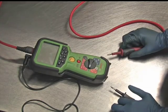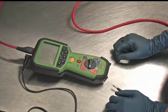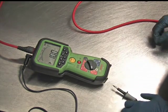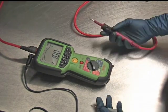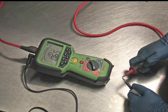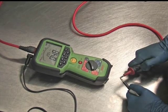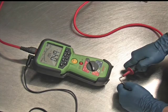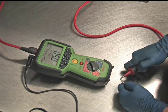With the FSA050 out of the box, the first thing we're going to want to do is make sure that our leads are zeroed. The way we do that is turn the dial down to the ohms section — it's the orange section down at the bottom left. It will come up and say basically greater than a hundred ohms. So what we're going to do then is touch the two leads together, and right now I'm getting a reading of 0.48-0.49, which is fluctuating. After it settles down a little bit, we're going to hit the black test button.